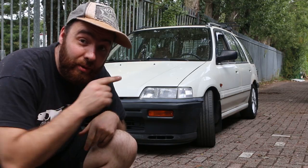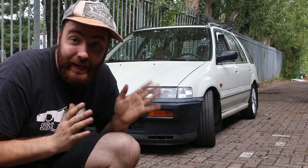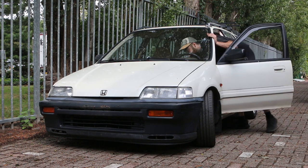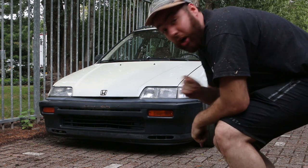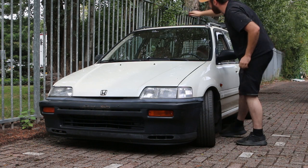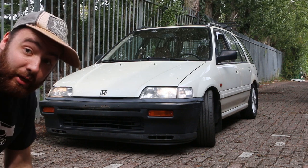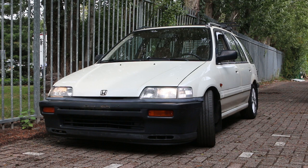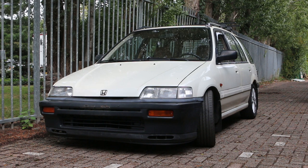So let's test it out. I'm going to start the car and then put my hand on the sensor to see if the lights turn on, then take my hand off and wait to see if the lights turn off. So currently it's off. Time to test it out. That looks like it's on. Now just wait a few moments — I believe the period for it to turn off is 20 seconds, and as you can see it just turned off.